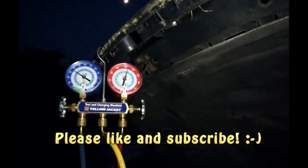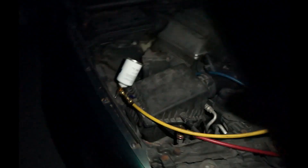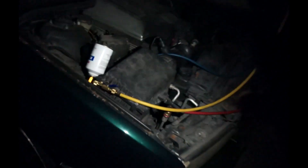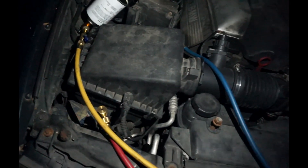The temperature outside dropped to about 80 degrees and the AC fan will no longer kick on because the engine fan is sufficient to keep the AC happy. This should be fully charged — I'm calling it. Now the wrap-up steps: make sure you close your two valves — low side and high side — before you disconnect the gauges. For the remaining can with refrigerant, leave the ball valve connected and close it off so you can use any remaining refrigerant without exposing it to atmosphere. To pop the couplers off, just pull up on them — they can get a little hot. Put your caps on and you're done. For your vacuum pump, make sure you drain your oil every time because it will absorb water and moisture, which is bad for your pump. Refill and drain it every single time you use it.